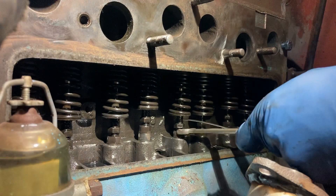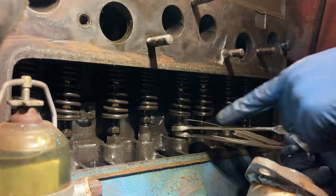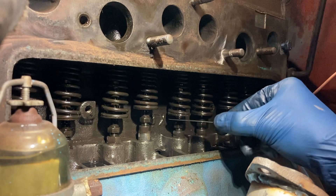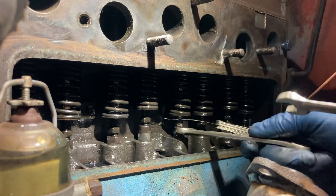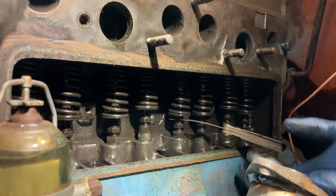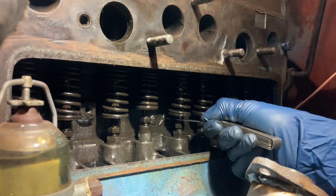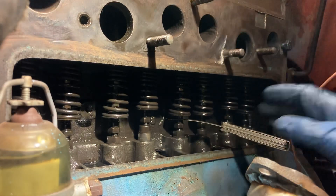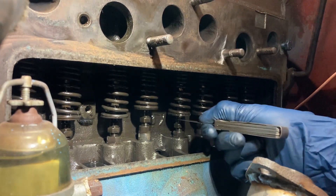Take your two half inch wrenches. There's no lock nut — these are just a friction fit so they don't wiggle as the engine runs. Since this is tight, we're going to tighten that nut down and that should make a bigger space for our feeler gauge to slide in. When you stick the gauge in there, you can adjust with it in there. You don't want to lift the valve and crush the feeler gauge — it should be a friction fit. It shouldn't crush it but also shouldn't slide in too easily. So now we're going to raise the top nut on the lifter by loosening it. It's a fine thread so there's pretty good adjustment. Now it's a little tight, so just a teeny bit of a turn — so it doesn't fall in, there's a little bit of friction and it doesn't fall back out. That's 15 thousandths.